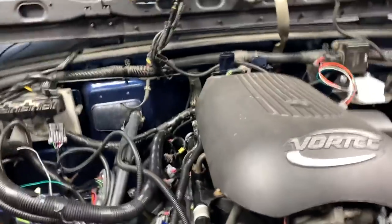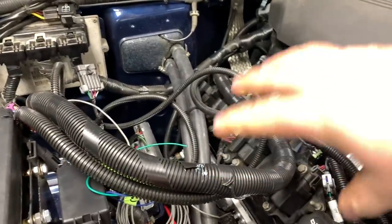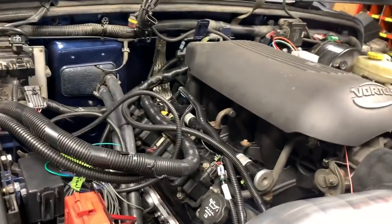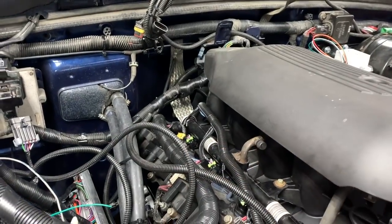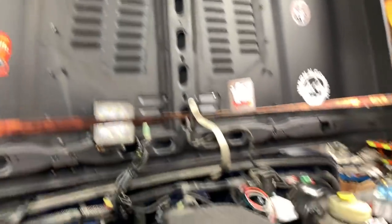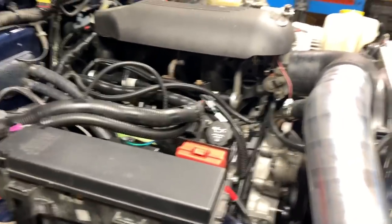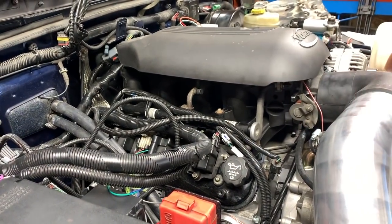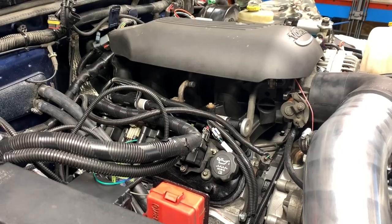Set up like there. I didn't really do too much research on it and I understood that you would be sucking up hot air from the bottom. I was gonna try to build a little cone and maybe suck up from the vents, but further research turns out anybody who's had their air intake for the LS swap up there, their intake temperatures are too high.